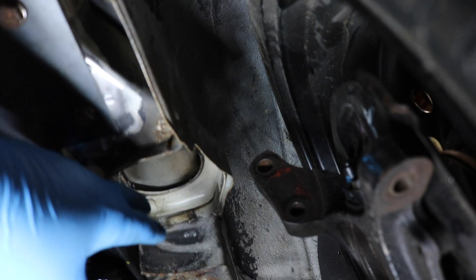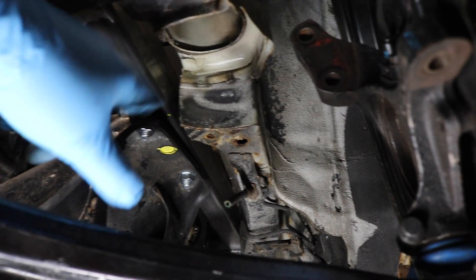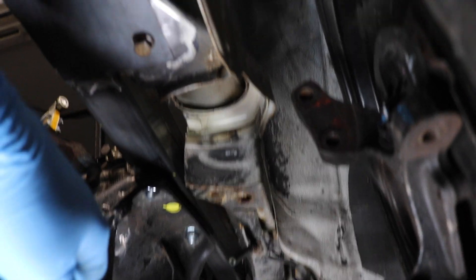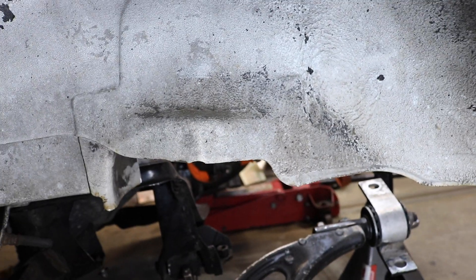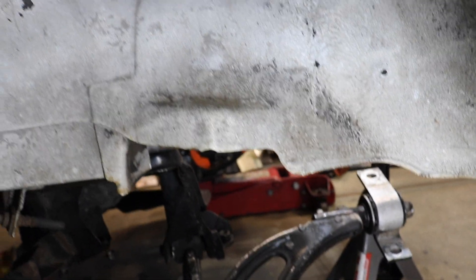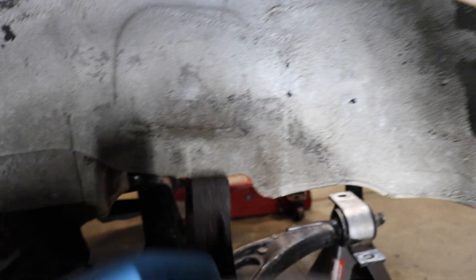This is the area I was worried about, where I tied into the factory frame rail. So we're going to cut out the spring perch and the inner wheel well and see how we make out in terms of getting the strut in there and what else we have to cut out. The spring perch is this reinforced area right here where they threw some extra metal layers on — and that's right where our strut needs to go. This should actually work out pretty good.